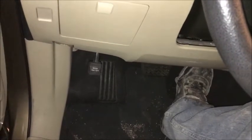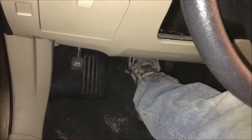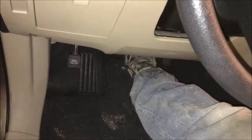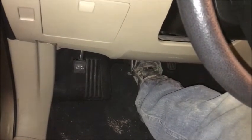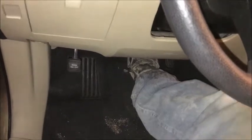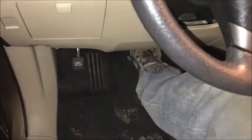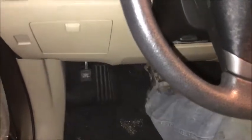Now we'll start the car and do it again — you'll notice it got easier. After a couple more pumping cycles, we now have a regular foot brake. We don't have to worry about bleeding this system at all. Brakes feel good.